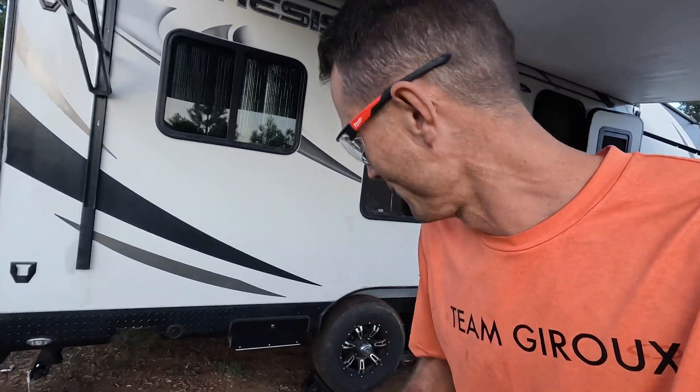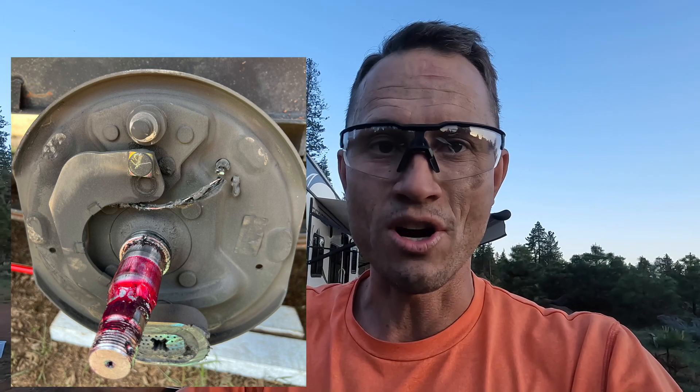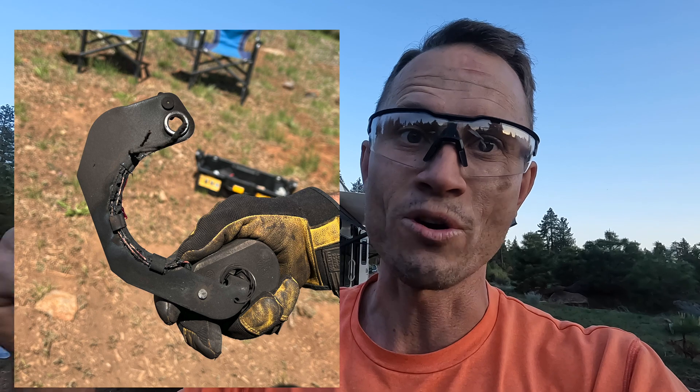I really think it was the breakaway cable. Now we're going to drop that last wheel, pull the truck forward, brake, go backwards and brake — that should help reset the self-adjusting brake system. The back right tire does not brake right now. Three tires is better than zero, which is what we've had. I wire-nutted the power supply coming from the back left tire through the axle because I don't want any shorts inside the hub assembly. The green wires are totally exposed, so I cut those wires. Back right tire will not engage brakes, but again, three brakes are better than zero.